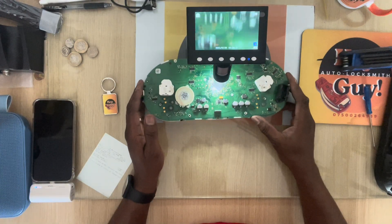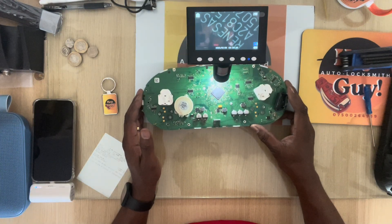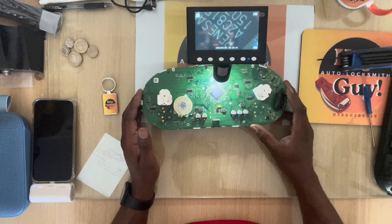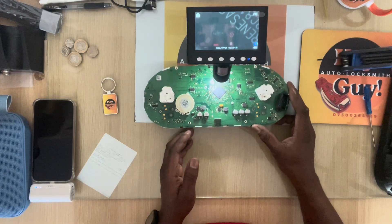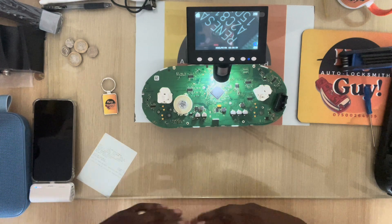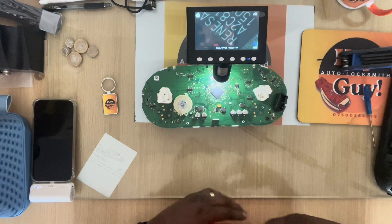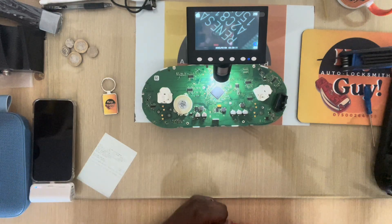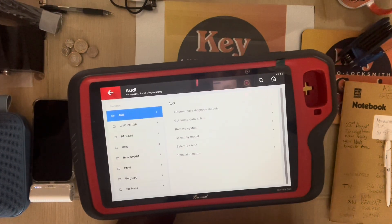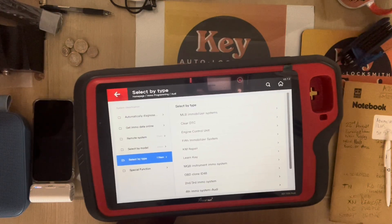So for this part number we need to use our microscope. We are using our microscope — okay, so that's our part number right there. With this part number now we pull out our programmer and we start the soldering or whatever process — if it's adapters, if it's soldering — then we move along from there. We need to identify our instrument cluster type and then we can align our adapters.